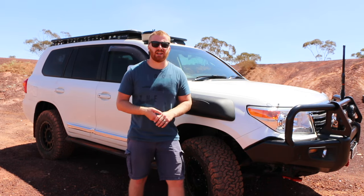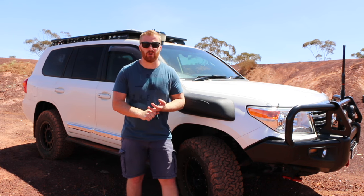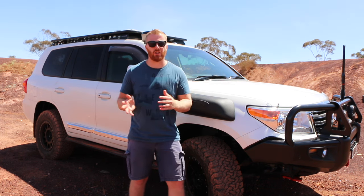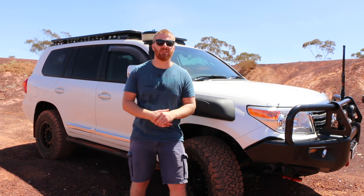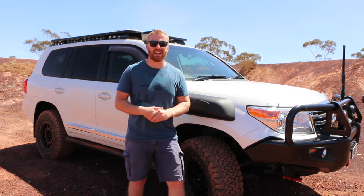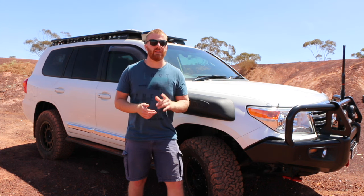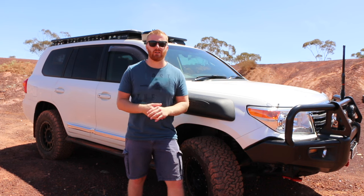The last function we're going to talk about today is turn assist. Turn assist can be used when you're in low range and in crawl control modes, and it's used for turning around in tight spaces — it reduces the turning circle of your vehicle. This system uses additional braking force to the inside turning rear wheel, which assists in dragging the car around. We're going to jump inside the car, go through how to activate each of the systems, what it looks like on the dash, and then try it on some of these obstacles.